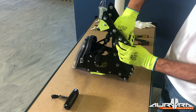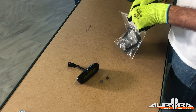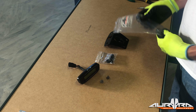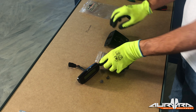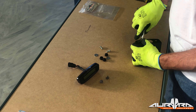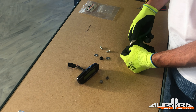Put the indicators on the Aurora Navigation Tower. Take care of the cables, they can easily be damaged. Be careful not to bend the fins on the tower. Do not pull or push them in any direction. Install the warning lights in any of the five available slots on the navigation tower. We recommend installing the supplied retaining rings to secure the warning lights in their place, otherwise they can generate a rattling noise.